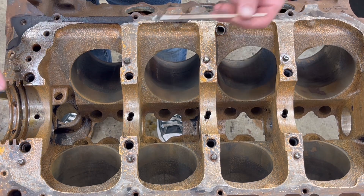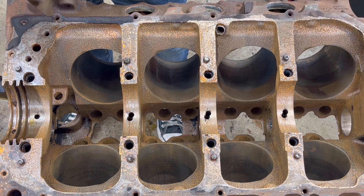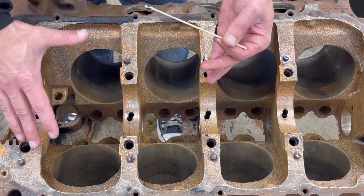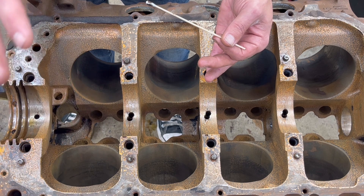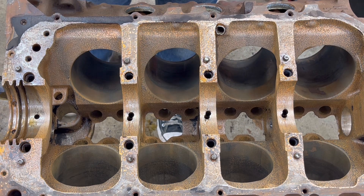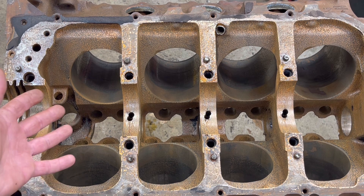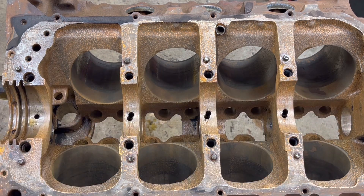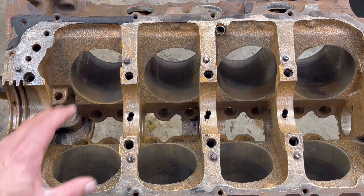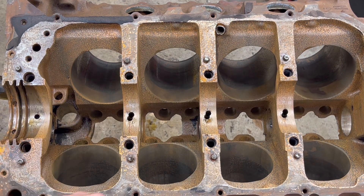All these are going to different areas to feed oil. Another one — yeah, that's pretty nasty. You really need to go to a machine shop and get these hot tanked. I know a lot of people are going to disagree and say you can get that clean — just keep trying. I'm telling you how to do it the right way based on how I was taught: get the majority of the heavy gunk off, get it down to a bare block, and take it to a machine shop. Why not spend $30, $50, $100 to go to a reputable machine shop and get all that clean, get it all baked out? When you get it back, all the holes that feed oil everywhere are clean.